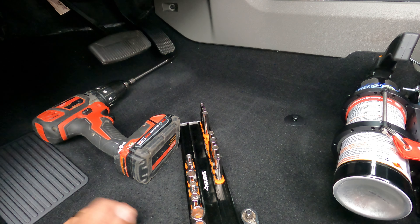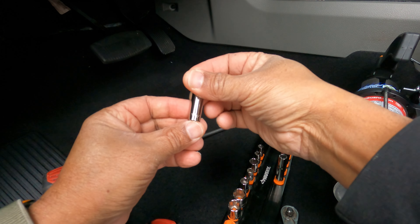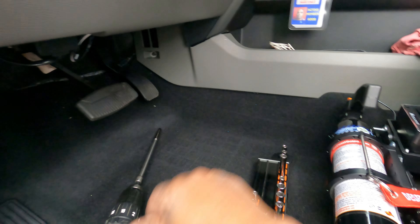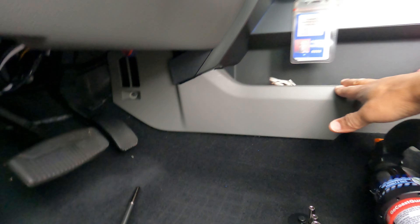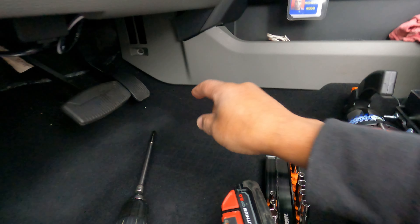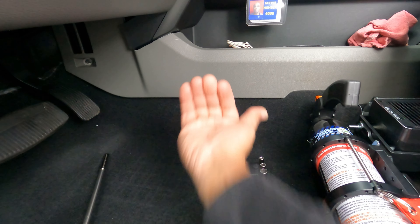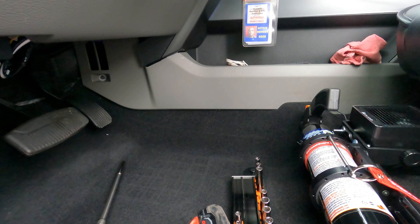To get this started, you're gonna need a couple of tools. First, you'll need a 9/32 socket. What you're gonna do is go down and remove this panel — it's held by just one screw. Once you loosen that, we're gonna remove this panel because it's much easier to install with it off. These panels are held with push tabs, so you get underneath it, pull toward you, and you should feel it pop off.